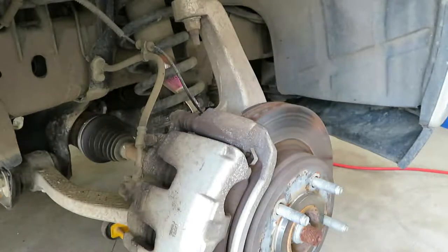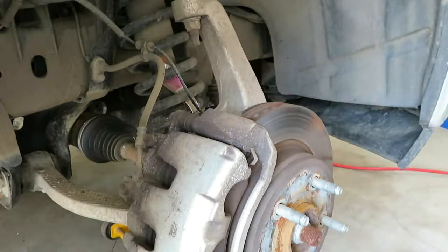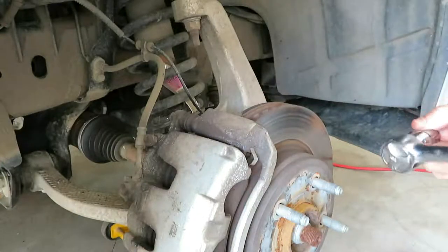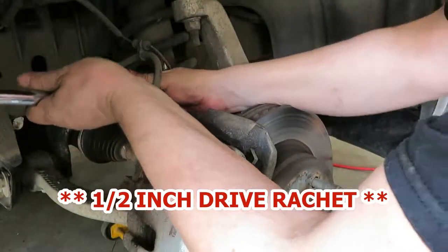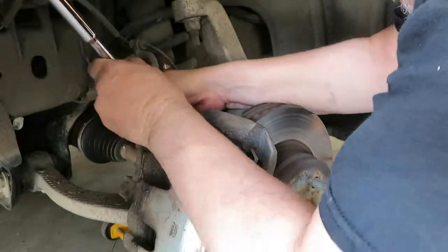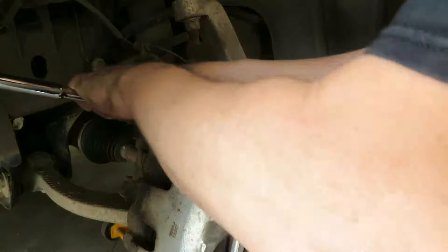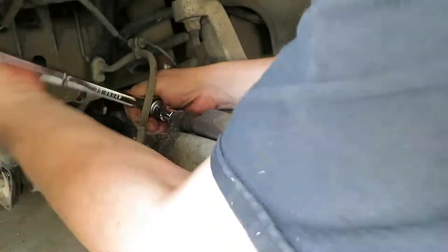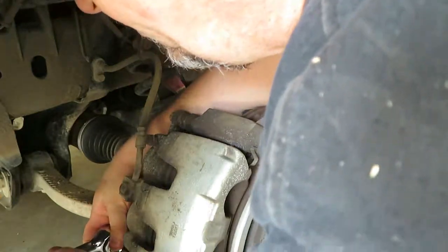You can see I've got my wheel off already. One of the first things I'm going to do is take the spacer off — that's the spacer that is part of my fancy wheels — set that aside, don't forget to put that back on. Next step is I'm going to take the caliper off the caliper bracket. For that you need a half inch socket; I'm using a three-quarter inch drive just to get a bit more leverage. Over time these bolt heads get corroded, so sometimes it's a little hard to get your socket on there. Loosen that one off and loosen the bottom one off.